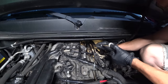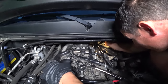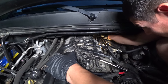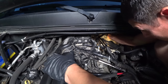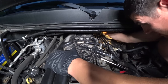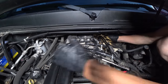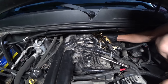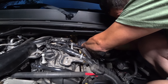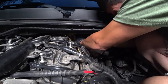I'm going to wiggle this back there so you can get the swivel and that socket onto the sender. I was amazed at the commentaries and efforts that everyone else went through — it's ridiculous. Just get the right deep socket and a swivel, and then work for a little bit. You can see that's the six-inch all the way on and it's already connected. So just a little bit of pressure there — and there it is.